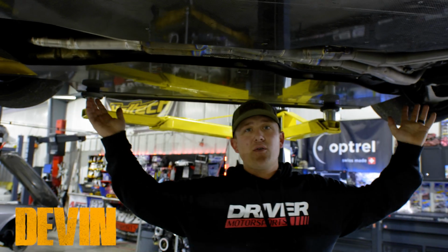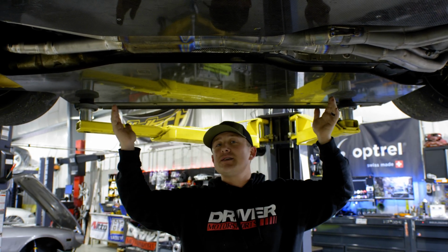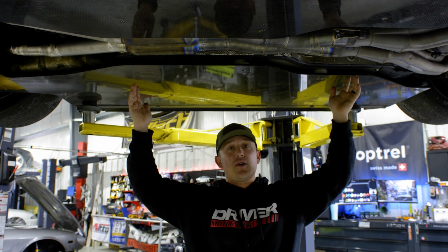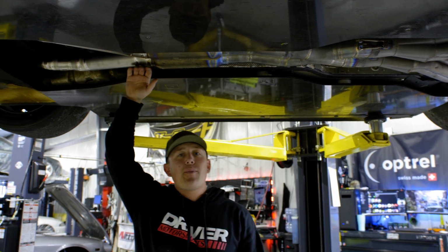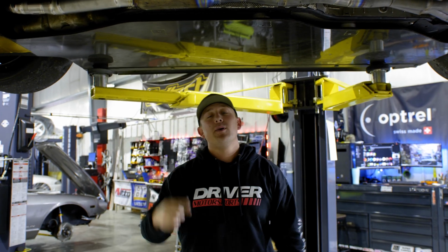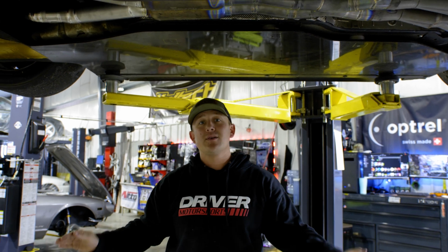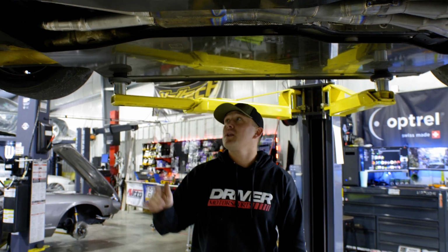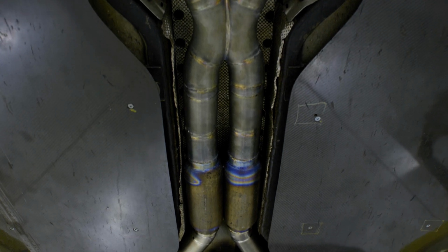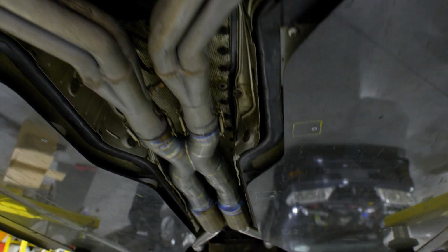I introduced this Corvette. So, just a brief recap. Probably two seasons ago, we built this exhaust for Ben. It was dumped right here, right behind the seat before the axle. Since then, he has put a flat floor on, and because of the flat floor, it was allowing exhaust fumes into the cabin. We don't want that for him. So he brought it back, and we knocked out a complete catback exhaust on this C5 Corvette. We did some brand new titanium pieces and some utilizing the factory C5 Z06 titanium exhaust.